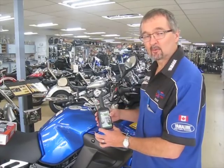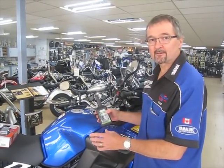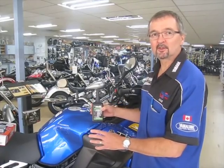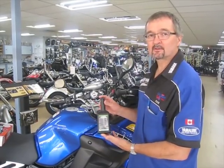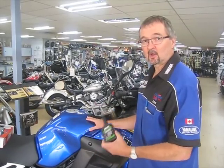This is much more important now than it was 10 or 20 years ago, the reason being that there's ethanol in fuels now. So these new ecologically better fuels do not keep like they used to 10, 20 years ago. Add the appropriate amount of stabilizer to a full tank of fresh fuel and run the machine long enough to make sure that the stabilized fuel gets through the whole system.